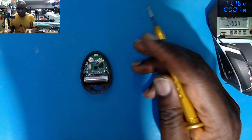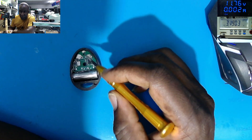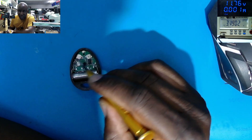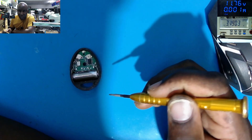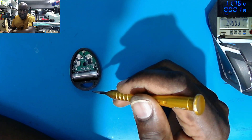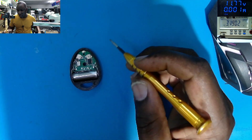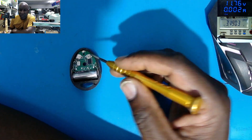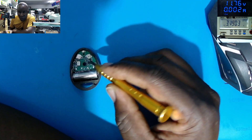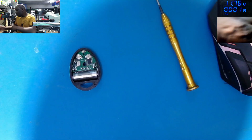So what we did: we replaced those switches. These are the key fob switches for the Isuzu — we don't know the model of the car. We replaced them with switches which I took from donor laptop motherboards. A switch is just a switch. What these switches are doing is sending 12 volts to ground.